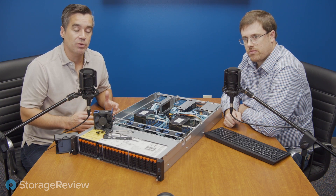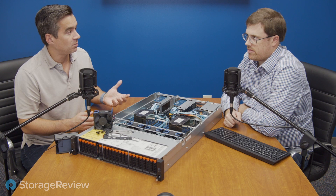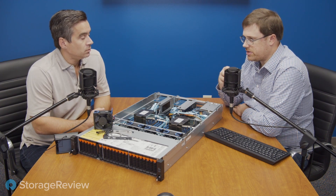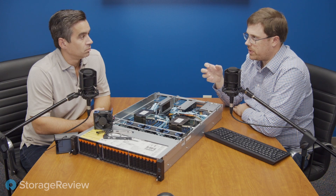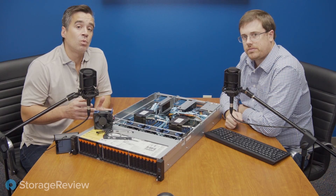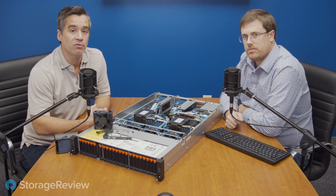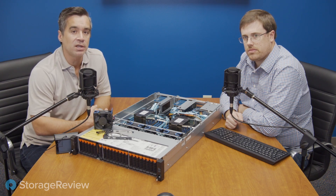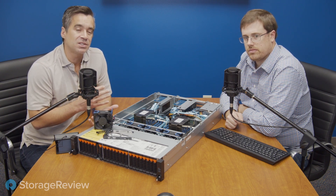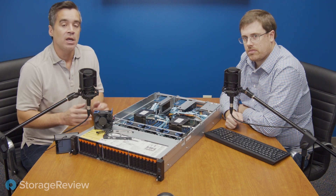While still on the front, it is only PCIe Gen 3 compatible — there's no Gen 4 support here, which is a little bit of a letdown because Gen 4 is one of the best things about the new AMD platforms. With Gen 3 you can get into areas that saturate the CPUs, but for single-threaded performance to an individual drive you have double the bandwidth available with a Gen 4 product. We'll have another project coming soon showing Gen 4 drives in the front, but that's not to say this platform lets us down from a performance standpoint — it still does a really good job.